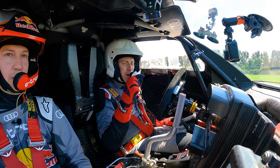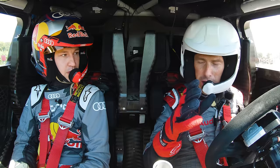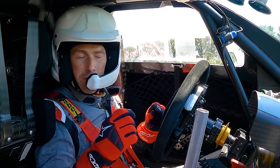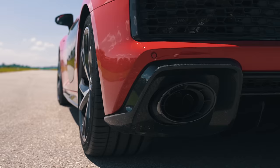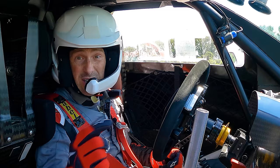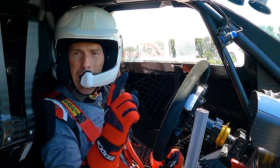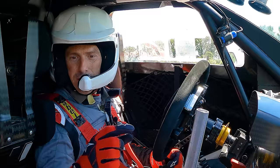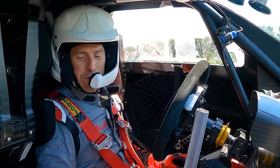So with 680 horsepower, there are no gears for me to deal with - it's dead simple, just accelerate and go. It's basically like a road car: left foot on the brake, full throttle, release the brake and go. The R8 has a seven-speed dual-clutch automatic gearbox with launch control, drives all four wheels, powered by a 5.2-litre naturally aspirated V10 with 620 horsepower and 580 Newton-metres of torque. However, the R8 is a lot lighter - just under 1.6 tonnes versus this car's 2.2 tonnes.